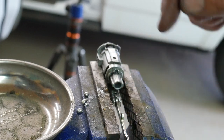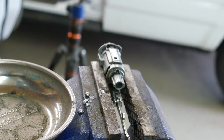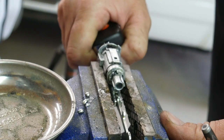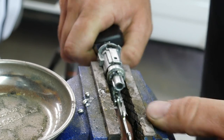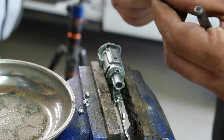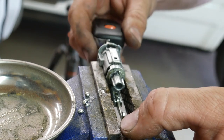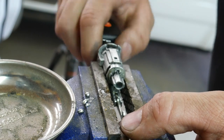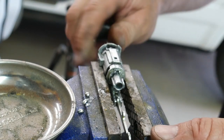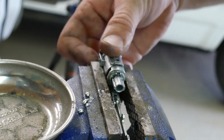Okay, the unfortunate thing is the key code on the lock cylinder matches the key code that was on the glove box. So maybe this is just a lock cylinder that's worn out, because I can get some rotation out of it. So it's probably only one tumbler holding this up. Maybe we should verify that our key cut as expected. But I'm just going to go ahead and pull it apart since I'm already this far. Then I can confirm our wafer positions.